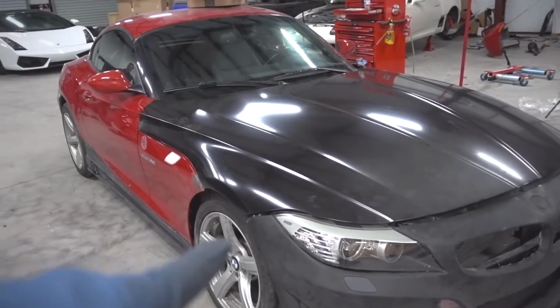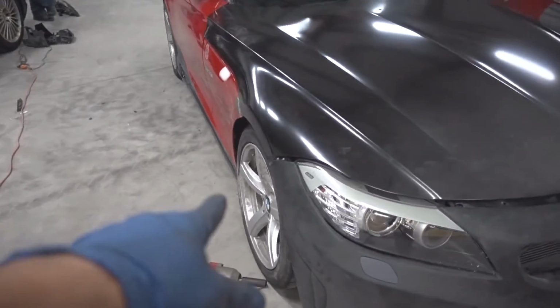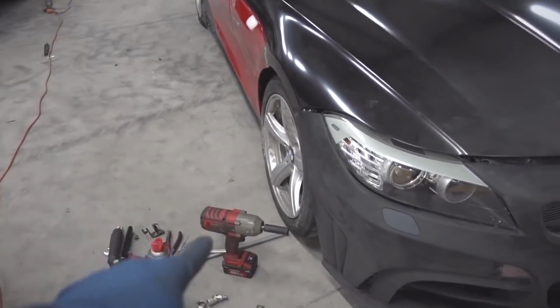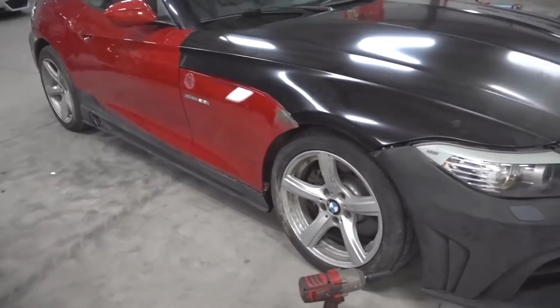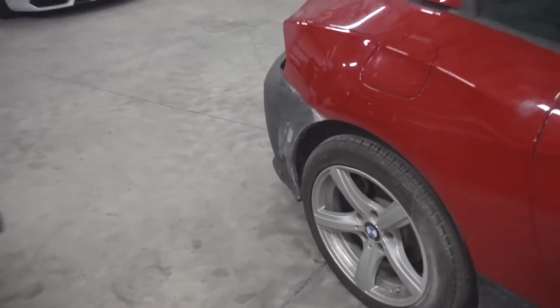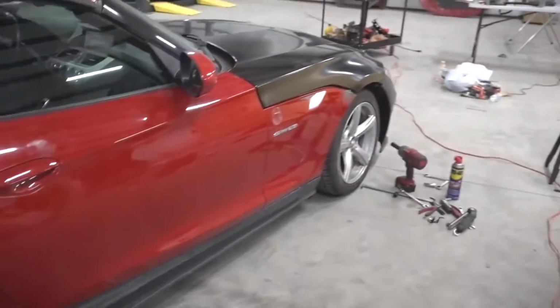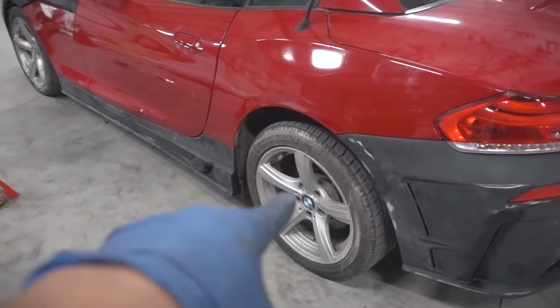Okay, the hood isn't closed, and that's why there's a bit of a gap, but it also needs a little bit of adjustment from the camber area, but we can adjust that with the coilovers. Now, if you take a look at the difference between this and the rear, you can see a huge gap right here, and over there, it's very, very minimal. And if you take a look on the other side, it is basically the same thing. There's actually a really big gap here.